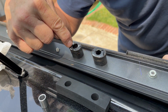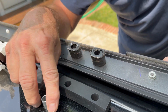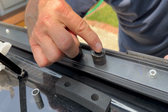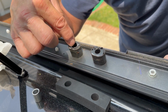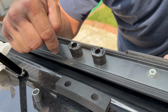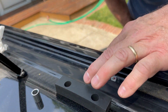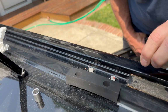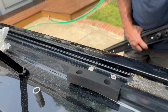All right, I'm looking at the factory roof rack here. These are also pieces that would slide over the plastic factory bushings. I can't tell if this is some sort of glue residue, but I guess I'm thinking it is. There's a bit of elasticity to it. So I'm thinking the factory had some silicone here originally also, and that this was used to seal the weather out of those holes. So I feel better about putting silicone, at least a little bit, around the outside of these plastic tubes before sliding the aluminum over it. And then this will seal out the rest. Maybe one drop on each side, so it looks like it'd be compressed and create a weather seal.